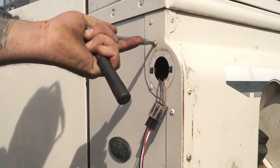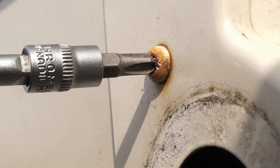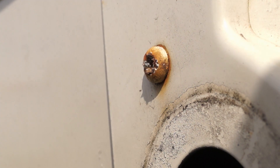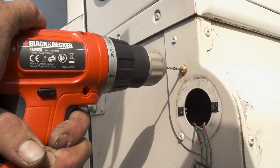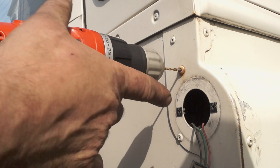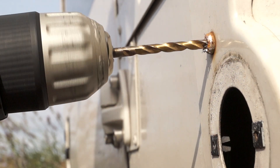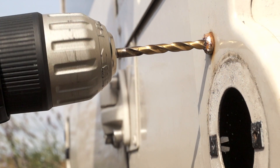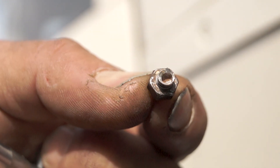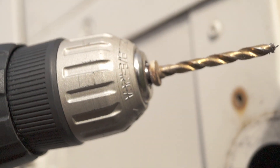The second little trick: you've been there when you're winding a screw and it slips — your screwdriver bit slips in the old screw head and you can't move it. This is a pain and it slows the job up. One way you can do it is to pilot a hole first through the centre, just below the head of the screw, and then use a larger drill to take the head off. As long as you use a drill slightly smaller than the bolt head, that will come through. You can see where I've drilled it, which has come out quite nice and hasn't damaged the bodywork.